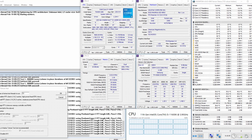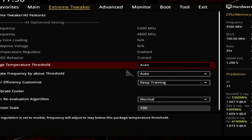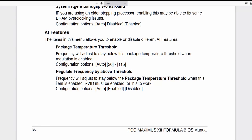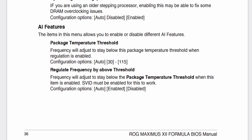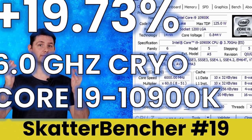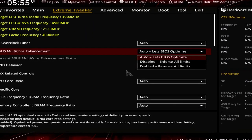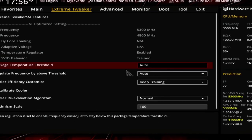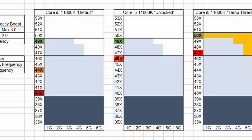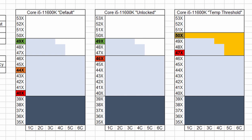Let's move on to our second overclocking strategy, which features the package temperature threshold feature. This is one of the AI features included with most Asus motherboards, allowing the user to target a specific maximum package temperature. If the CPU package temperature goes over this threshold, it will automatically reduce the frequency in a dynamic process. Since Asus has unlocked Turbo Boost power limits by default on Z590 motherboards, they have also enabled the package temperature threshold and set it to 90°C by default. With custom loop water cooling, there's much more thermal headroom, allowing us to overclock all cores to 5 GHz — 100 MHz higher than the maximum single-core boost of 4.9 GHz and 400 MHz higher than the maximum all-core boost of 4.6 GHz.